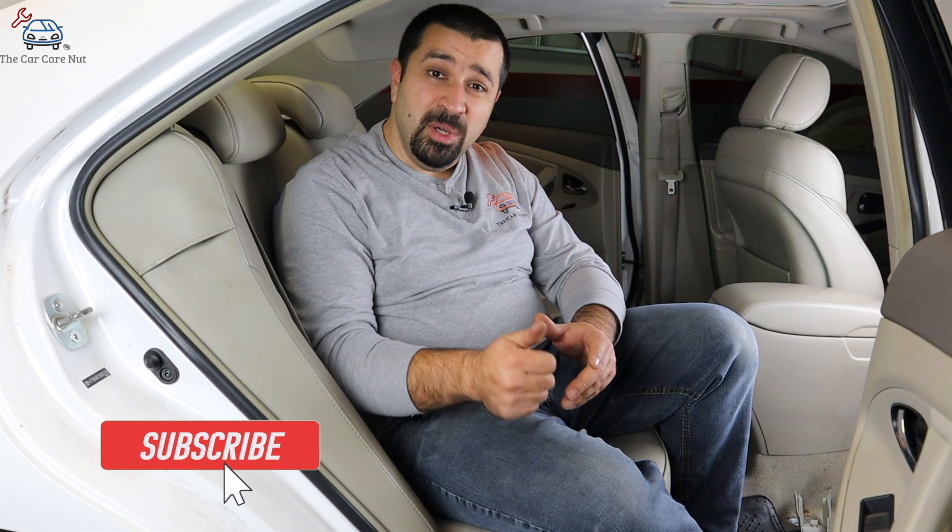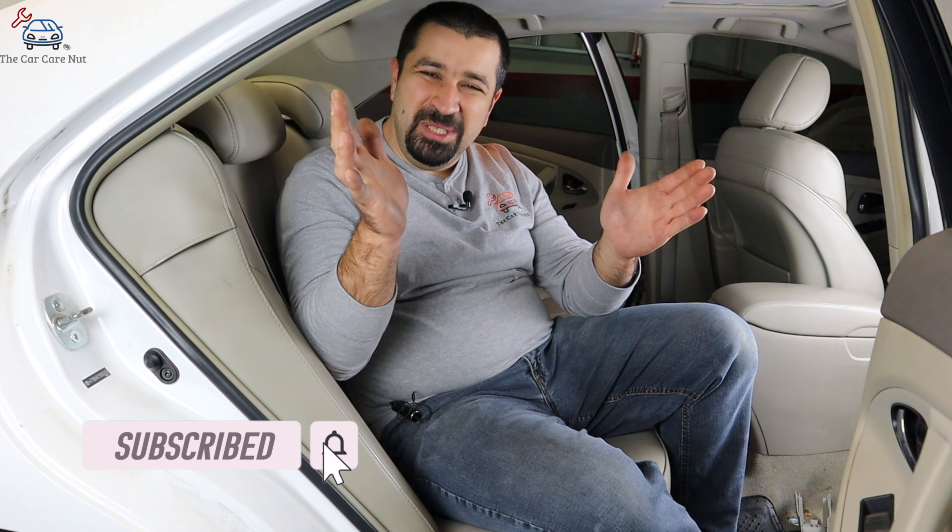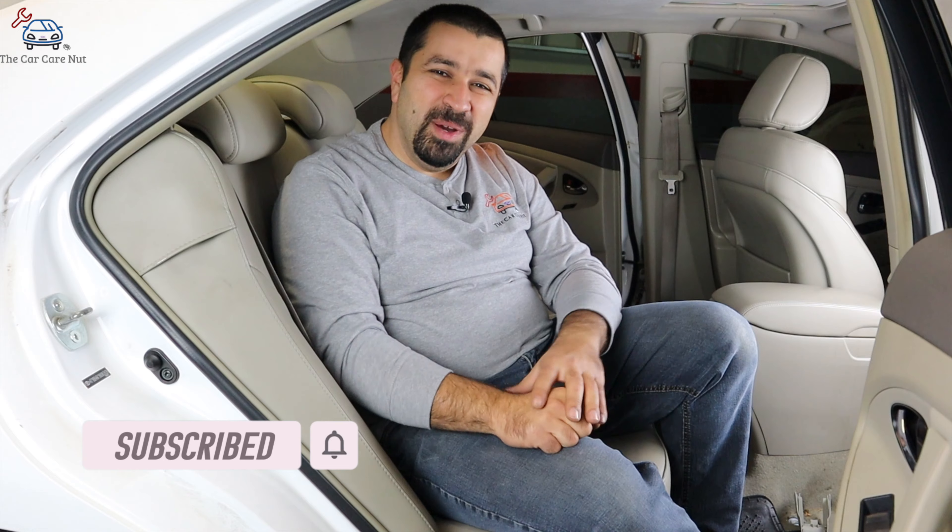Now you know how to clean the fan. It's a little bit of a complicated process, but the good thing is you only do this once. Install the filter and you should have no issues. Remember, I say this in every hybrid video: a dirty fan is the number one cause for premature high voltage battery failure in Toyota hybrids. I hope you liked this video and learned something new. Consider subscribing and giving it a thumbs up. May the Lord bless you — have a wonderful day.